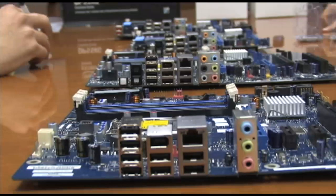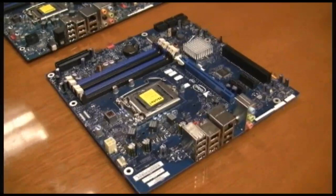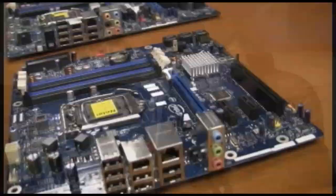And then what about this board — the DP55WB? This board we've really pulled out — we've almost stripped it down. What we wanted to do with this board was have an option for folks that wanted to get onto Core i7 and Core i5 but wanted a more price-sensitive type of system. Get some of the high-quality processor and fast speeds but in a budget price without all the extra stuff they're not going to use. It still has PCI Express 2.0 at x16, it doesn't do dual graphics, but you'll still get the great performance of the latest processor. It still has four DIMMs of memory for DDR3, and all the support of USB, RAID, and 1394 that you get from the other boards — just cut down on price.